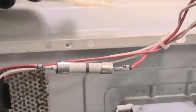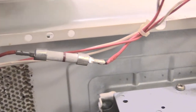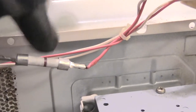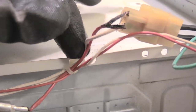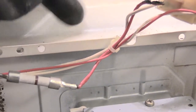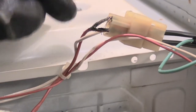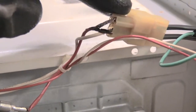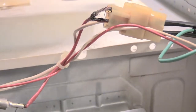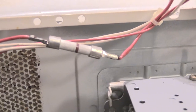I removed the holder case that the fuse goes into, so you can see the fuse right here. You'll need to disconnect the two lines that go to this fuse to replace it. But on this one it's burnt up, so the whole red wire will need to be replaced. You can disconnect the red side from where it goes onto the fuse, but you also have the white side — you really should replace this whole plastic piece by unplugging it, because it could be damaged or melted all the way up inside the housing.